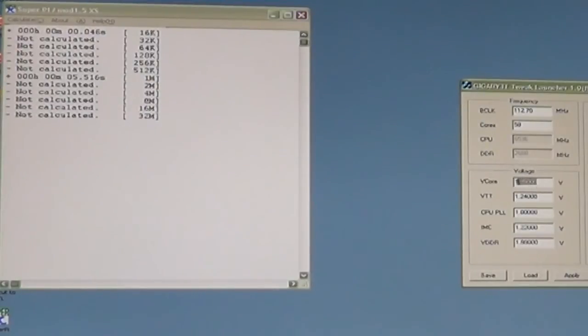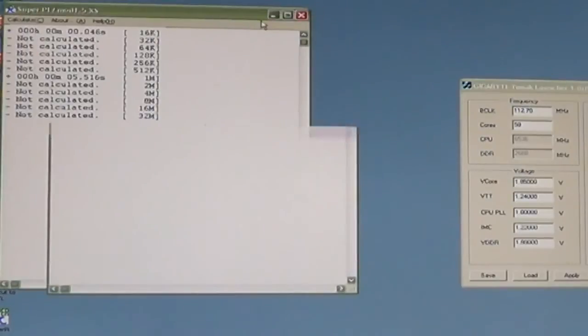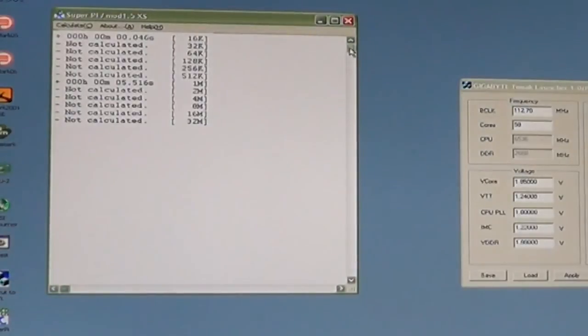Okay, I'm taking it up to 1.95. Scary enough, my CPU still scales at this voltage and this temperature, but you need to find the right balance between temperature and volts, because if I volt too high, the CPU will get too warm inside and stability will get worse. So more volts doesn't always mean better. So just test for yourself.